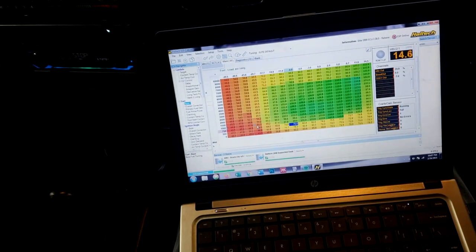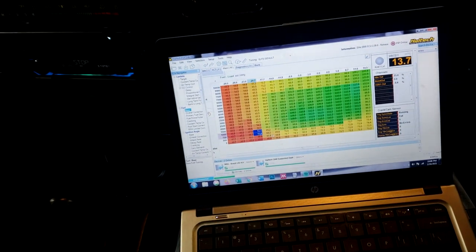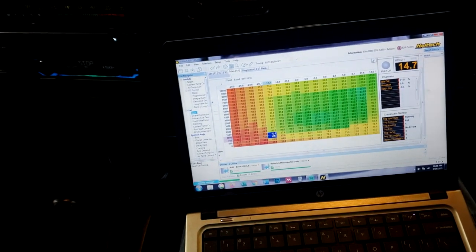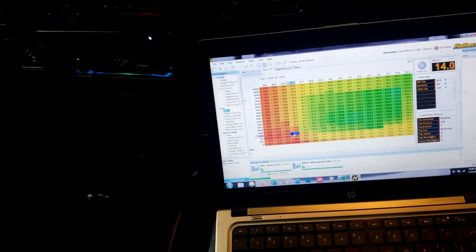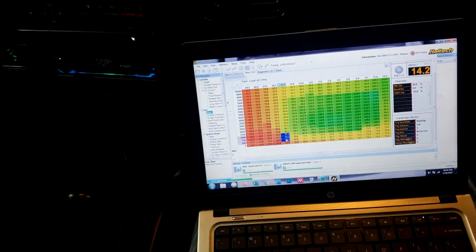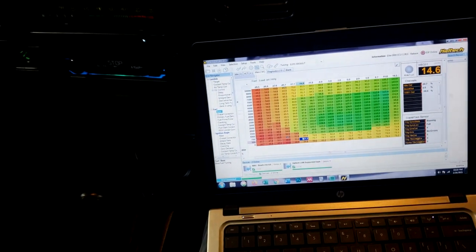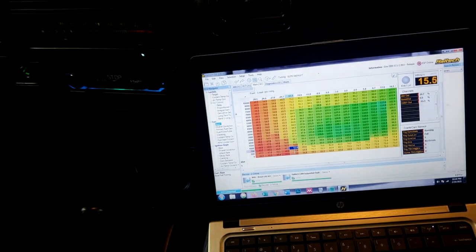So I've noticed the fuel trims — the fuel trims are like negative 10 right now, so it's trying to pull fuel out. But really that's about the target and how close the target is to what it's doing. I'm going to play with these numbers a little bit. I wonder if these boxes along the side here are affecting it — it might just be a really big jump from 49, and it's got an idle box up to like 60. I cleaned it up right there — it cleaned up the air fuels.